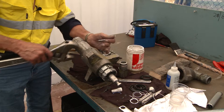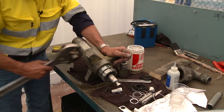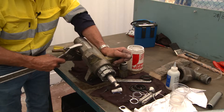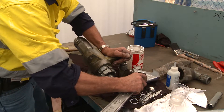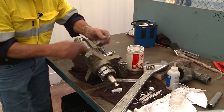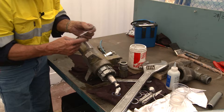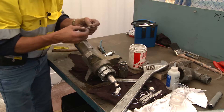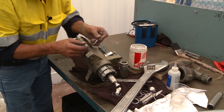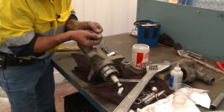The flat section of the cylinder needs to marry with the pin, so you adjust it around until you get the flat section to marry with the pin without damaging the thread. Gently sit that there for the moment. I suggest you definitely put some anti-seize on this pin, primarily because it is open to the weather and is in a piece of cast.